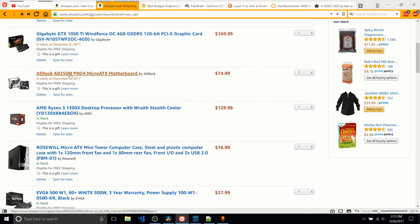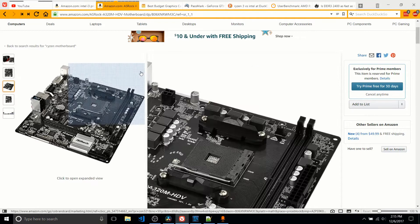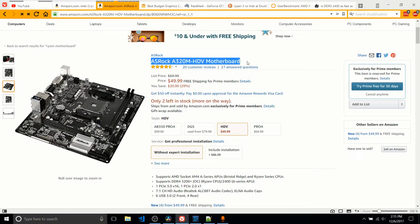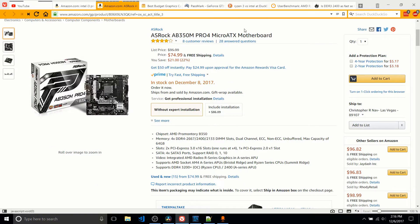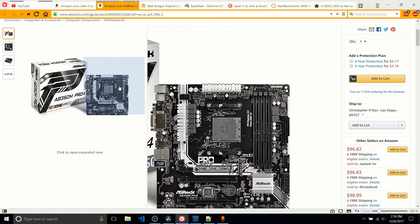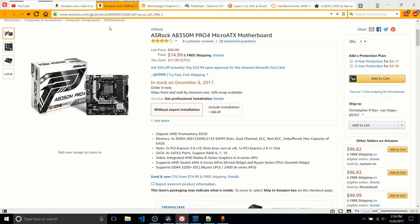It's actually the slightly downgraded version of this ASRock motherboard. The $50 version — the main difference here is that it only has two slots of RAM. But of course since this is a budget PC build, there are only two RAM slots being consumed, so this prevents you from having the ability to upgrade later on into 32 gigabytes of RAM. But if budget is your key and you want to drop that down as close as possible to $600, then this version of the motherboard — which I'll link down below — rather than the mostly the same but with two extra RAM slot motherboard, the ASRock AB350M, which as you can see is $25 more. If you want that ability to upgrade your RAM, it might be worth it to go with that. The base build is going to be using that because to get the $50 version of the motherboard it does require Amazon Prime, but I get the feeling a lot of people probably are using Amazon Prime already anyway.